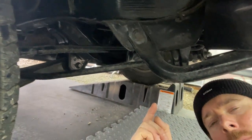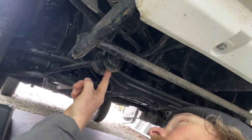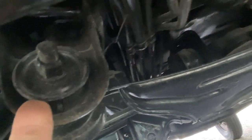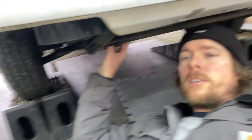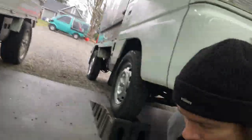If you're getting an Acti or you already have one and haven't noticed — this stabilizer bar goes back to your lower control arm. The bushing — you can see it's cracked. It's good to replace that because it's going to make your Acti feel a lot more stable, maybe less death wobble. Being new to an Acti, it's safest to replace any ripped bushings that affect stability, because they get a little squirrely going fast. I don't think they were designed to go over 60 miles an hour.